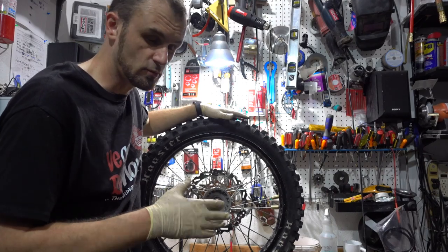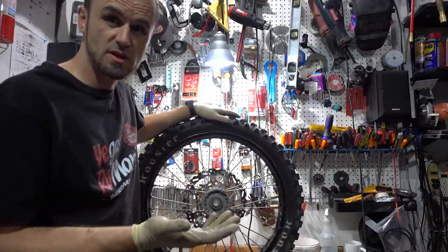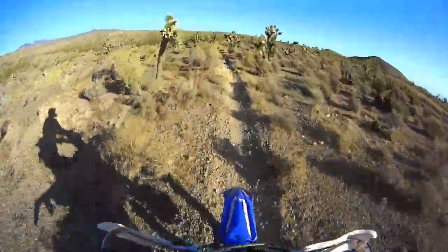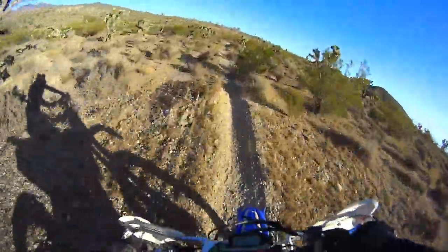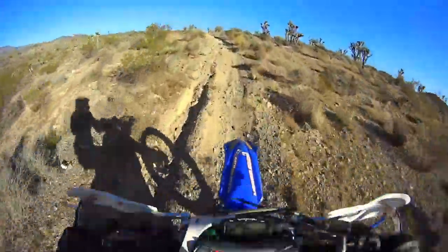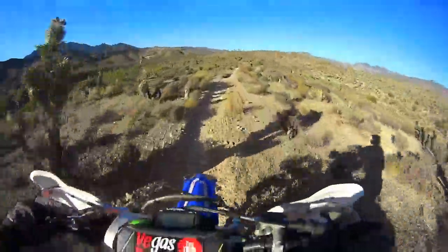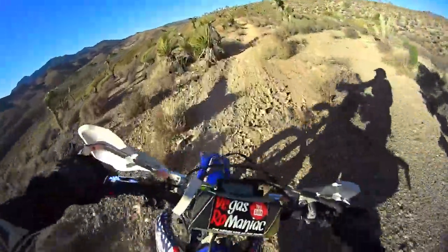The mousse and filler are in. What I don't have is the ability to adjust pressure, but what I do have is 100% reliability — and that's one of the biggest problems with mousse: how do you fill up the front when it shrinks, or when you change tire sizes? This might have just fixed that. Hopefully it lasts as well as I think it will. Once a mousse shrinks, you either find another one, make two out of two, or find some kind of filler material. This feels good so far and I want to see how long it keeps feeling good.